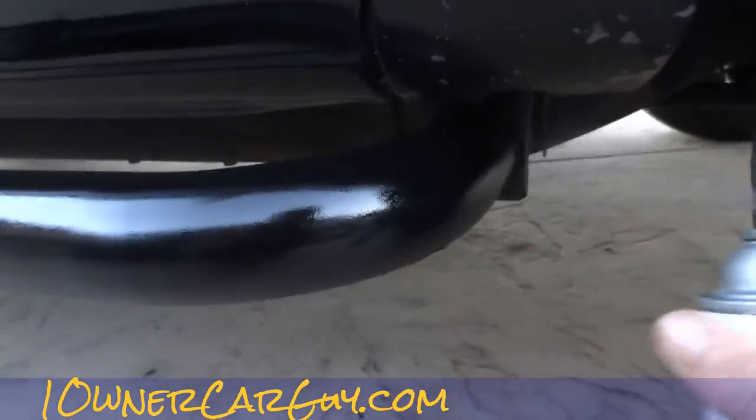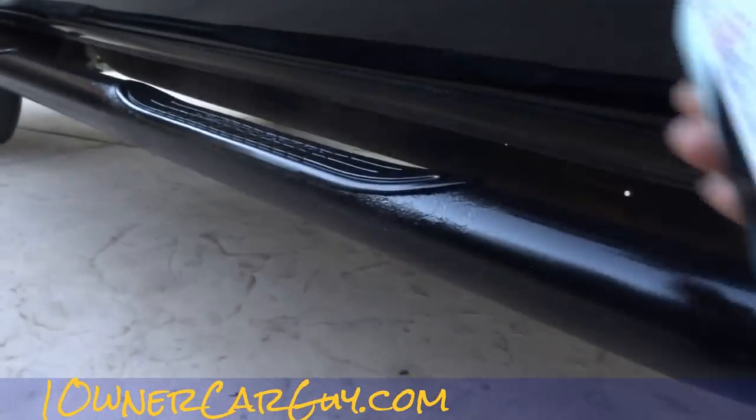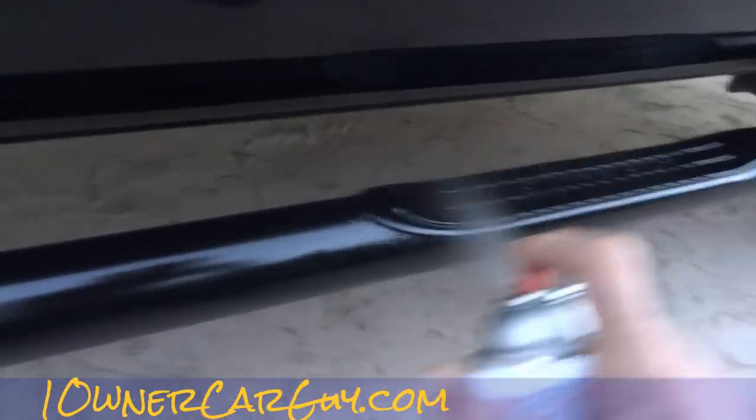It's just a quick how-to, quick fix video. Don't be afraid of it. We took some 220-grit to this and are painting directly over that. You could primer it, sand it down again, get it to look really good with no orange peel whatsoever. I'm just going for that satin, pretty good, almost undercoated look.